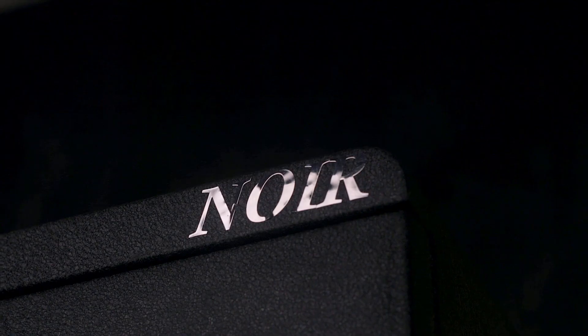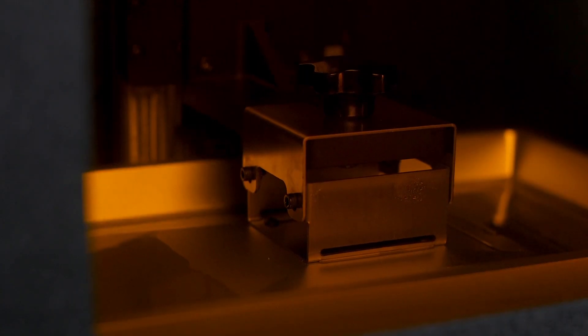Depending on which model Phenom you are working with — original, L, Noir, or Prime — the life expectancy of the LCD can change. In the case of the Noir, its specifications dictate that it has an average lifespan of 1200 print hours, whereas the LCDs used in the original and L are only specced for an average of 400 print hours. Print hours refers to the period of time that a print is actively running, so a 24-hour print counts as 24 hours into the lifespan; if you cancel that print halfway through, then it's only 12 hours off the lifespan. There is some variance in the longevity an LCD can last based on the resin used, layer height, print failures, and even how much resin you keep in the vat — all these factors can make an LCD last longer or shorter than the specified average.